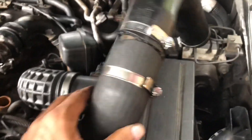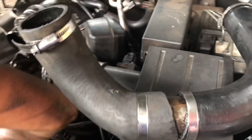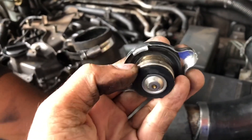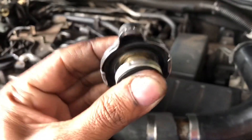We can convince the customer to change to the proper turbo hose, but it's all up to the customer to decide. We can give a recommendation so they can adjust their budget as well. And obviously this is not the right radiator cap — when the customer complains about overheating, this is something that everyone has to take a look at.